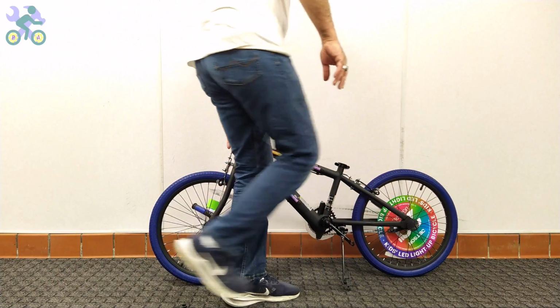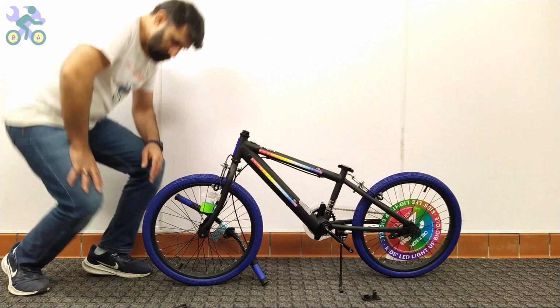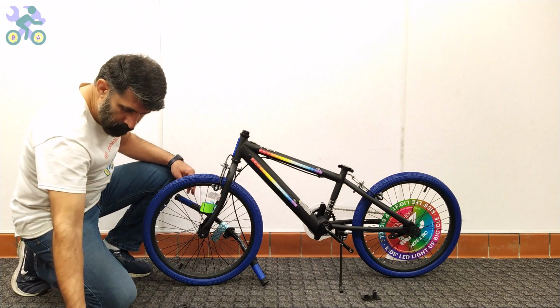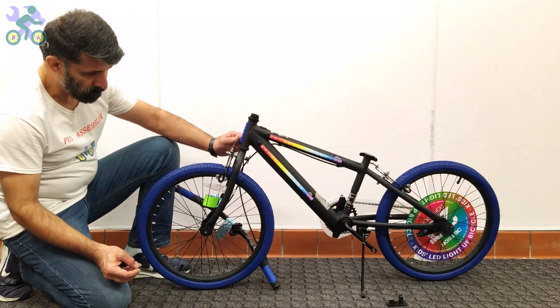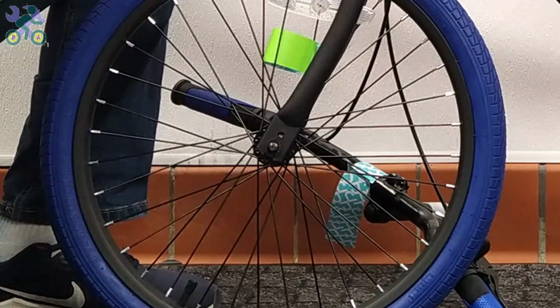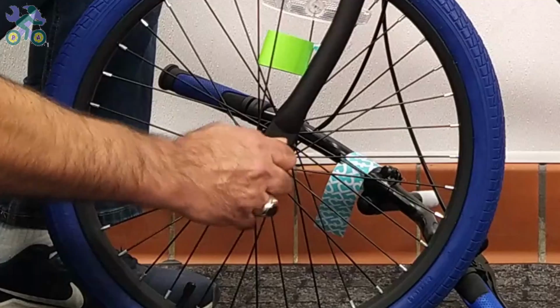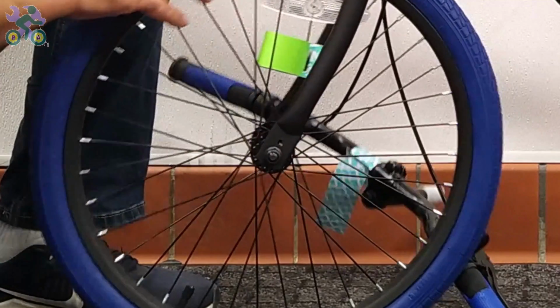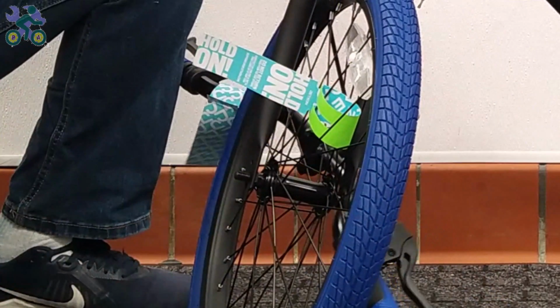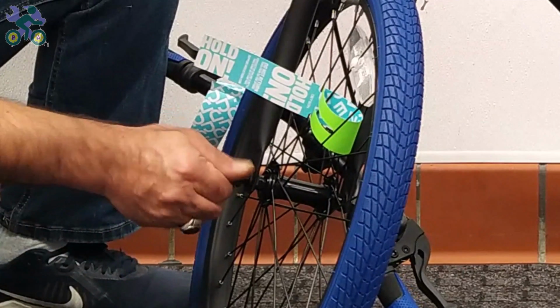If the fork was bent and you couldn't put the tire in the fork, I made a video and I've put the link in the description section below on how to fix it. There is a hole at the end of the fork. Insert the wheel retainer into the hole and tighten the head nut by hand. In only a few limited models, only washers are used for the wheel retainers. Repeat the same process on the other side.